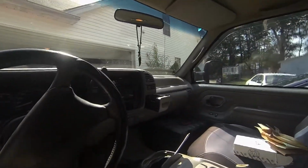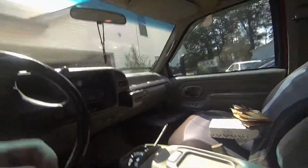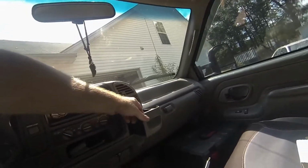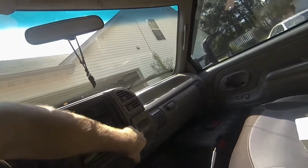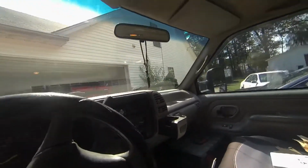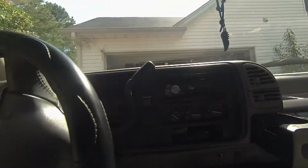Now I'm going to need to. Also, to make sure it pops out, your cup holder has to be out, because when it's in, it's partially one thing that holds it in. Okay. So I need to move this. You have to have the key. Oh, here's one thing. Have your tools ready, your screwdrivers ready, because once you move your left lever down to first, the key has to be in the ignition, and with your door open, you get that really annoying beep.